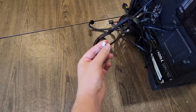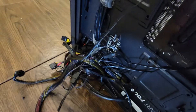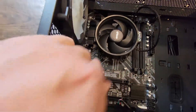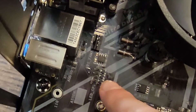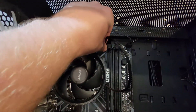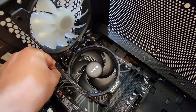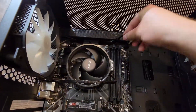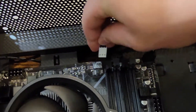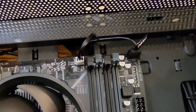Next, if you have a fan hub, you might have a little fan header cable that goes with it. We're going to take this fan header for the fan hub and plug it into one of our system fan spots. Normally I'd run it to the system fan header — labeled System Fan 1 — but because the cable is short, I need to plug it into the CPU cooler system fan area instead. The rules are the same as the CPU fan: match the tooth on the connector with the motherboard. There are only three pins; you won't need the fourth. With that, the fan hub is installed.